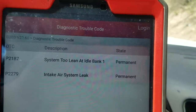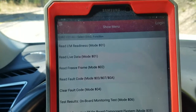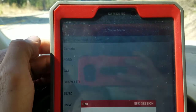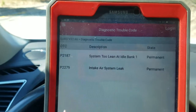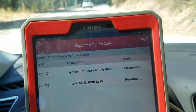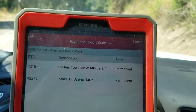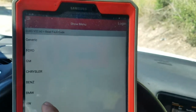No focus on the generic mode. You will see the generic mode - at the very beginning I was pointing there when it's a zero code, but look at it here on the generic side: those two codes are there permanently. So apparently when they are doing a new vehicle, they are leaving those codes permanently, even after you clear them. This can be misleading - some people may think they didn't fix the vehicle.